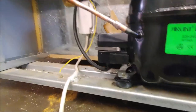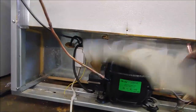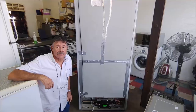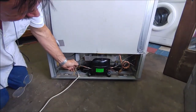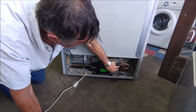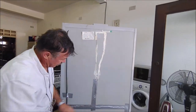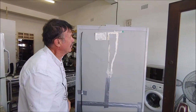I'll run it for a while, and when I'm happy, this is the defrost tray which I'll glue onto the top of the compressor later — first we get the temperatures right and make sure the cold plate defrosts when it cycles. I've put the right amount of gas in, pinched and closed it off, so the system is all sealed. There's the little pencil dryer connected onto the existing condenser, there's the capillary, and this is the wire that goes up to the internal thermostat. This is what the back of the fridge looks like — there's some duct tape on it but behind the fridge nobody will notice.